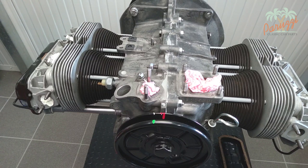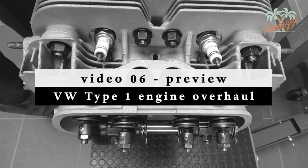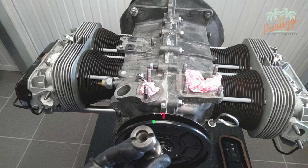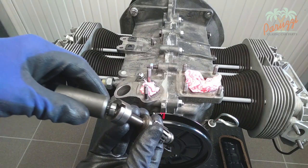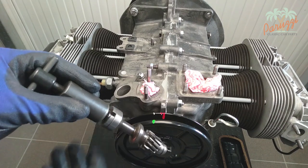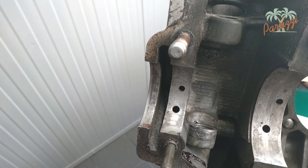Make sure that cylinder 1 is at top dead center compression stroke, when the spark plug of cylinder 1 is ready to ignite. Since the drive shaft is not yet mounted, you no longer have a point of reference regarding the position of the cylinders. If you do not know how to determine the compression stroke of cylinder 1, please watch video 6 before continuing. Now mount the drive shaft in the crankcase, with the narrowest part pointing towards the crankshaft pulley. Use the special tool to install the drive shaft, as explained in video 4.